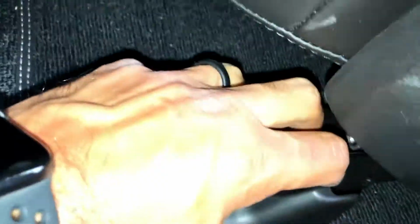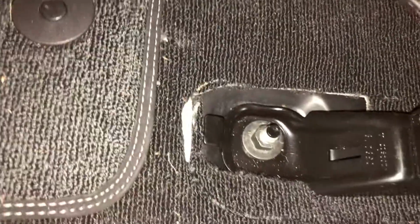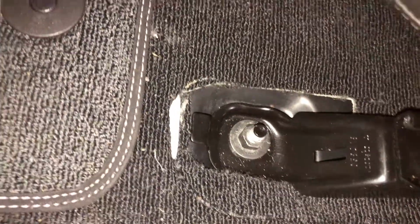Oh! Yeah, it is 45 degrees. I put a lot of effort into it. There. So now we will take 15mm there, 15 millimeter there, and the seat will be free from the car, but we don't take it out of the car yet. I think after you remove those two, the instructions are to run the seat forward again, probably so you can get it out the door.